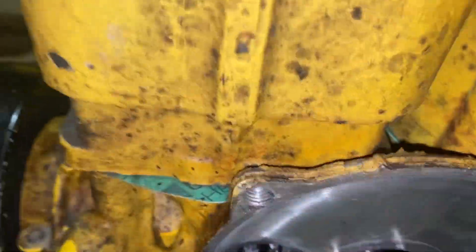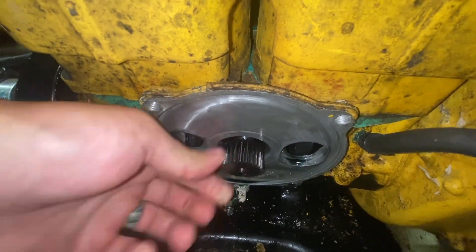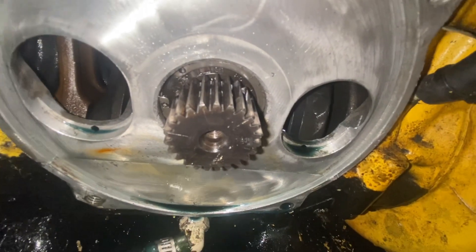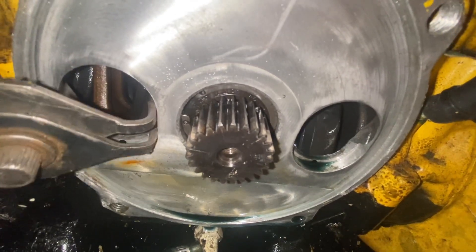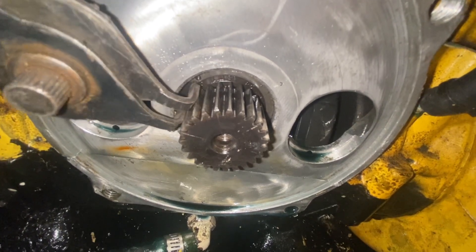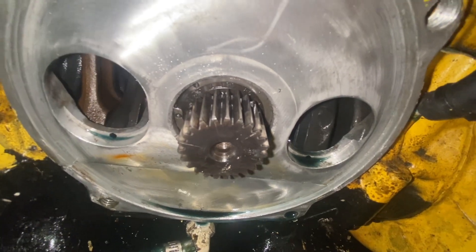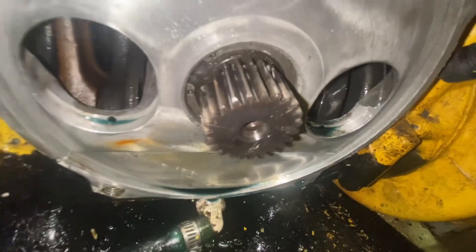It's probably stripped. Got the old sloppy - that's not moving the crank, that is just slop. And if you look in there, we just discovered the old snap ring, boys. There's no way I can do this through my iPhone - we'll do it off camera. I'm going to remove that snap ring and try to get her out. Snap ring removed.